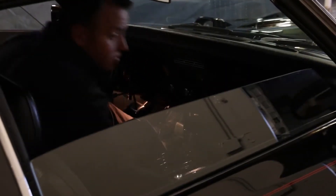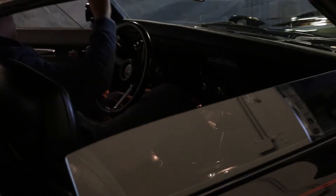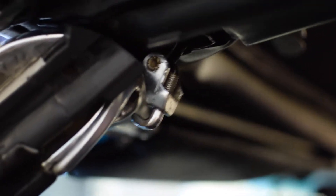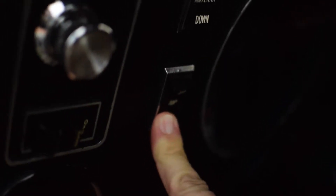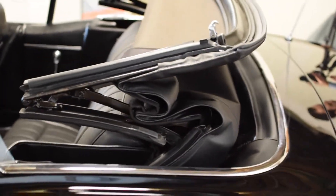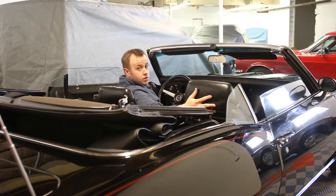To put the top down, start by rolling the windows down at least a little bit. Most or all the windows can be reached from the driver's seat. Then put down the sun visors. There are two latches on the side — once those are loose, pay attention to the hooks and make sure they're not catching as the top goes up or down. The switch is on the left side. Watch and listen as it goes down, making sure it goes down fairly evenly. And then the top is down.